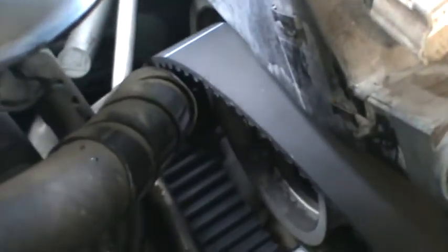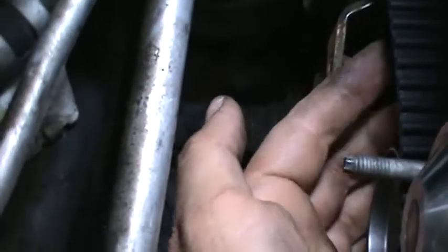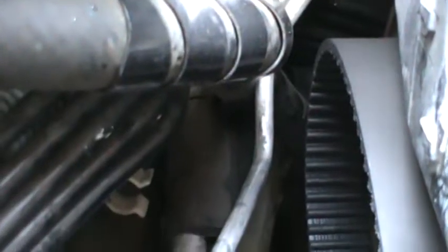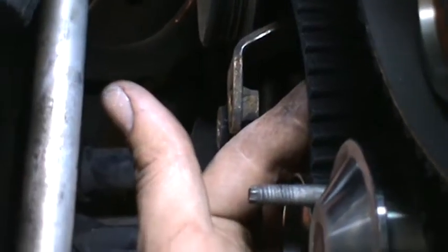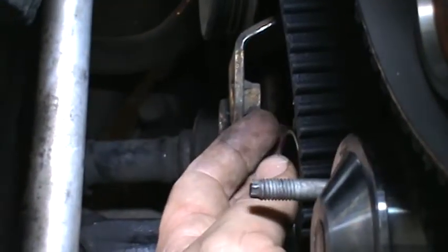So what I'm going to do is put it on there properly first on the belt. Make sure the belt is on just like it is right here, right on the blue — the white is on the blue right there, in the back. And then I'm going to wrap it down here and pull it up here, and they're going to hold tension right here so it doesn't come off over here. Now I'm going to go below. While they're holding tension here, I'm going to install the tensioner.